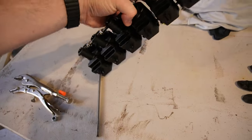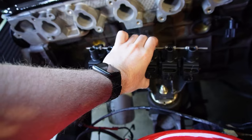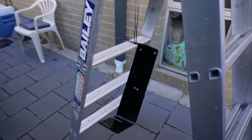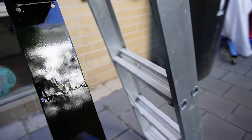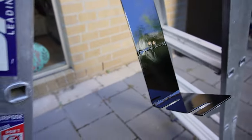The other day I went out and bought some LS coil packs. At first I was just thinking of sticking with the original coil, but in order to future-proof the car I may as well just spend a little bit more money and get some LS coils. Ollie thought of this genius way of mounting all these coils together - it's just going to sit and the leads are going to go in the stock position. Stripped all the coating off it, primed it, and put some black enamel paint on it, so it's going to look pretty schmick in there.